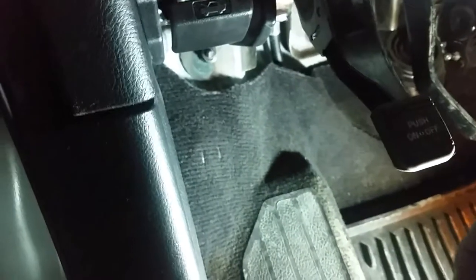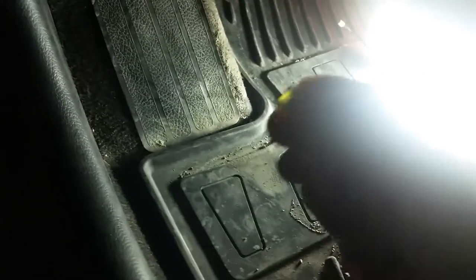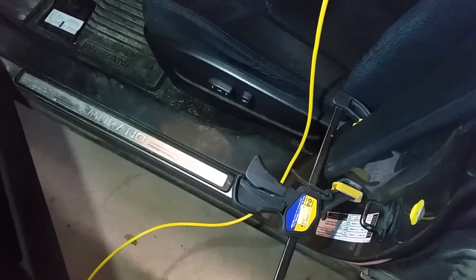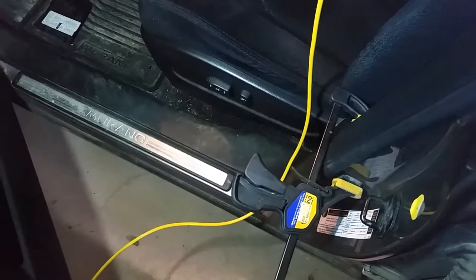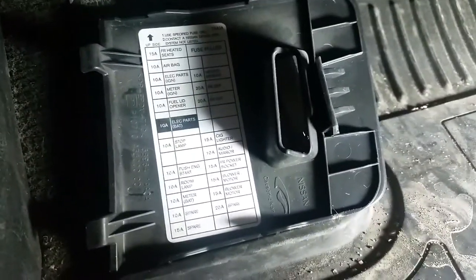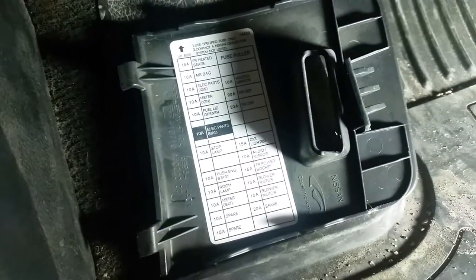You're gonna want to reach up and grab underneath the fuse puller. It has two little grippers — you snap it onto a fuse, pinch it, and then pull the fuse straight out. It also stores the fuse up inside the compartment so you can pop it out if you need to. Once we pull out the fuses, we're gonna check our multimeter and see if there's a drop in current. One important thing: when the driver's side door is open, the interior door light draws a couple of amps, so we need to disable that by clamping the door sensor shut. As we pull each fuse we're opening up each circuit, and that's how we'll determine which circuit is causing our draw.